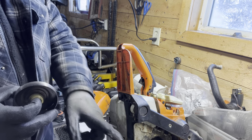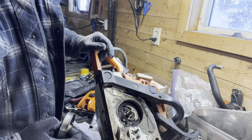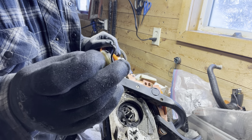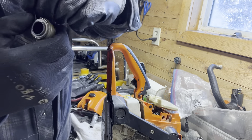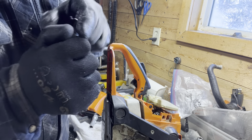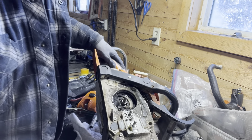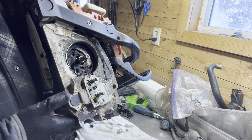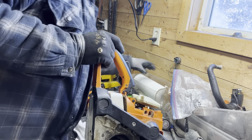If your saw is idling and the clutch isn't moving, it just sits there and doesn't puke oil all over the place — the way it should be. We want to look at those, make sure our threads are good and that the tip on the worm gear is still good, and that the steel isn't sliding around on it. This one's kind of at the point where it might be starting to slip — might end up replacing that. If we were getting more issues with oil or oil pump stuff and all that was still good, this is where we access our oil pump.